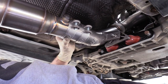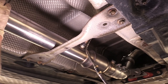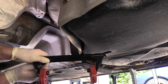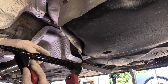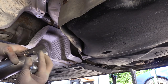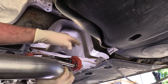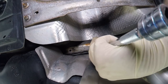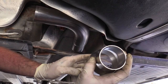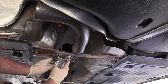Next, we're going to set our catalytic converter unit in, then install the bracket loosely and come back and tighten it in a minute. We can also clock our catalytic converter to sit about where we want it. Before tightening that clamp, we need to get the rest of the exhaust in. We do have some new hardware — this one came with new rubber hangers, and we're going to put a couple of new rubber hangers as we move back. Start by sliding our clamp onto our downpipe with a little lubricant on the ends — just a little bit of dielectric grease. We also have to make sure we get our fuel tank strap installed correctly — the easiest way is to put the strap inside the bracket first and then put it up in the car. Now we have this little reducer piece that goes from our APR downpipe to our AWE exhaust — the larger piece goes into the APR downpipe.